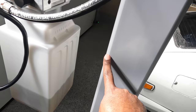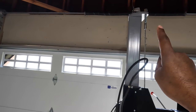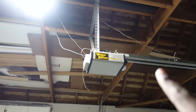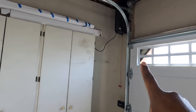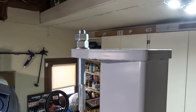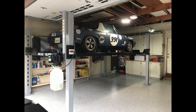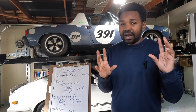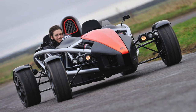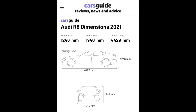This lift is just over nine feet wide including the base plate, and from edge to edge it's over 15 feet. The poles are almost eight feet high, which means my garage door won't clear them — I had to install the lift on the side and modify the railing. If your door or ceiling is low, consider the bolt height on top of the poles too. If you have eight feet or less, putting your car on airbags before loading it on top can help, or just buy smaller cars like an Ariel Atom.